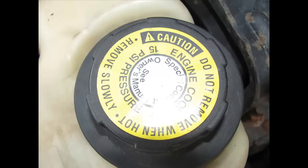If it's warm or hot, do not check any antifreeze or coolant on a vehicle. The best time to do this is first thing in the morning before you go to work. You want to make sure the engine is completely cold. You don't want to check your antifreeze five, ten minutes, or half an hour after you get home from work. After the car has been sitting for at least five or six hours is best, because there is pressure behind this and it is extremely hot — you will get burnt.